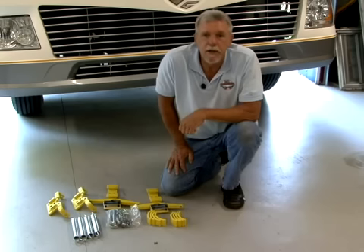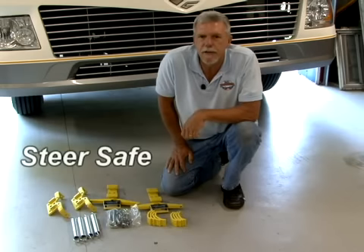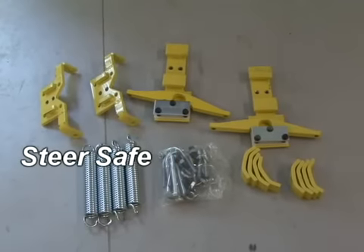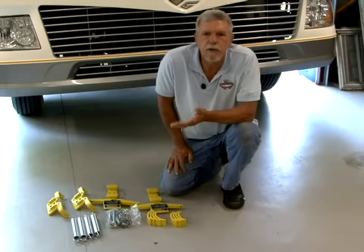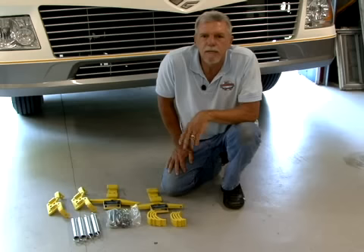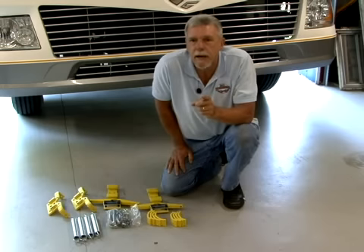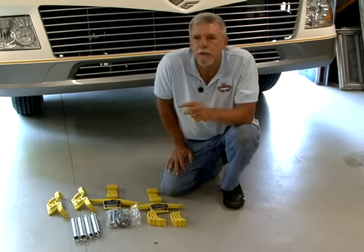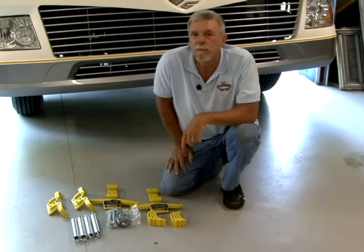I discovered a product that can prevent all of these steering issues when you're on the road. It's called the SteerSafe. SteerSafe is installed on your vehicle's front steering arms and simply clamps onto the front axle. There's no welding required, you just bolt it on. Once it's installed, the SteerSafe's patented oscillating fulcrum bar makes it the only true steering stabilizer on the market. It provides up to 400 pounds of preset tension on each front wheel, working against any outside forces. SteerSafe keeps your front wheels pointing straight even when there's a blowout.